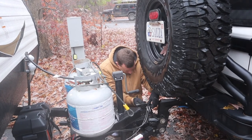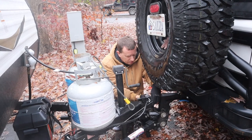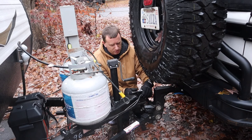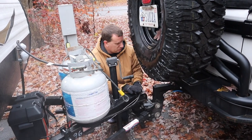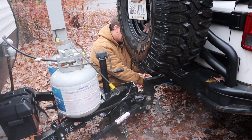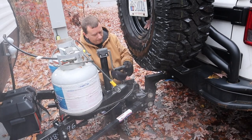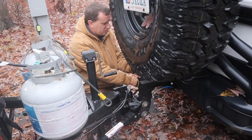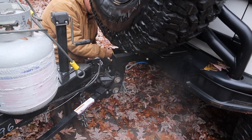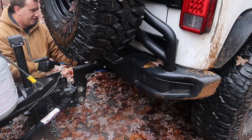So we loop it through this eye. I don't know all the state laws — maybe it's different in some states. Some people use a lock at this point, some people use a little clasp. Then this is for the brake line — you just attach it to something solid. On this, there's a flat spot on the top, and the flat spot on the top goes on the top. It always lines up and will click in to hold it in place. Make sure that there's slack here so when you make turns it doesn't bind up.